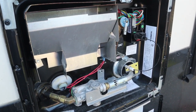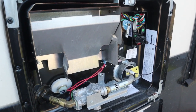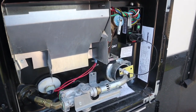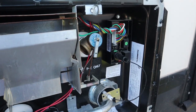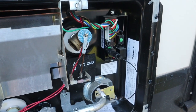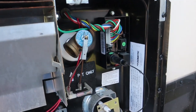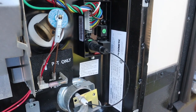Our water heater stopped working on gas the other day. We have a 2019 Grand Design Reflection 367BHS model. I started doing some research on Facebook pages and they said this circuit breaker right here could go out. I came outside, checked all the connections, and couldn't get it working — it still works fine on electric, but not on gas.